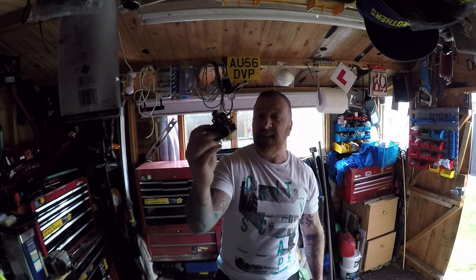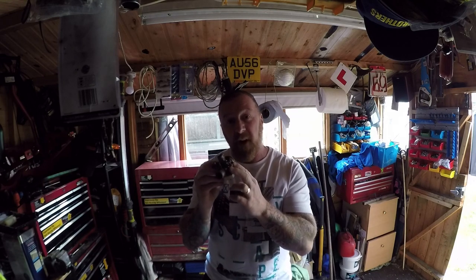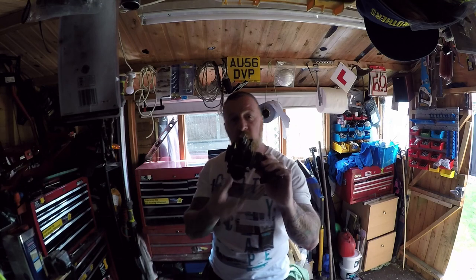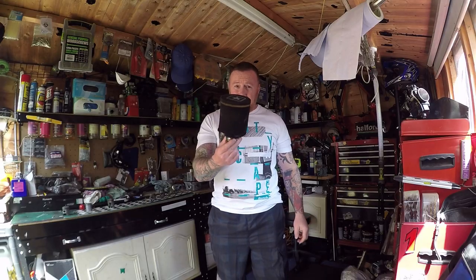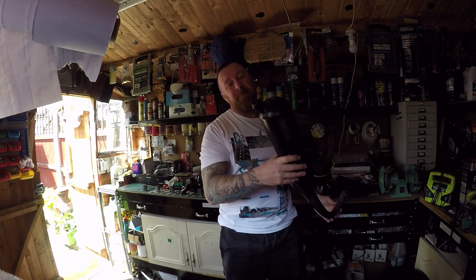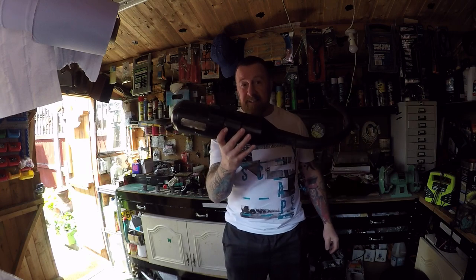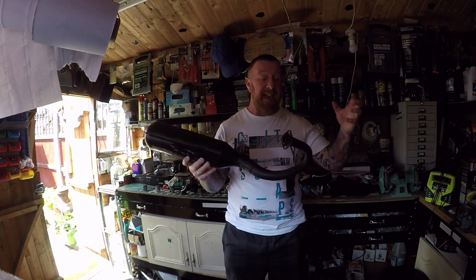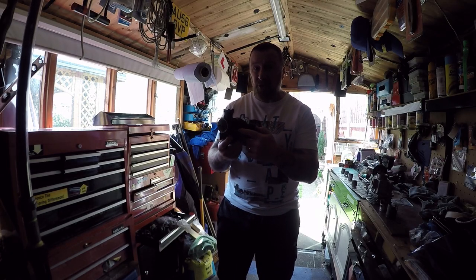Remember, your little tiny carburettor - 50cc, 17.5mm - is used to running just a 50cc piston. Why do you think it's gonna run a bigger one? Now a 17.5mm carburettor, you cannot just change from a 53 jet to a 64 jet. You can mess around with the air filter and the exhaust, but it takes tuning. Much more advisable to use a 19 or 21mm carburettor - that will now happily run a bigger piston and a bigger head. The very basics: more air in, more fuel in, bigger bang. And the gases have got to get out - not through your 50cc exhaust. It isn't gonna work if you've got a bigger piston and a tiny stock exhaust. It's not gonna work if you put a sports exhaust and a bigger piston in there and you've still not got more air coming in. It needs to do the whole lot, and I haven't even mentioned tuning the air-petrol mix.